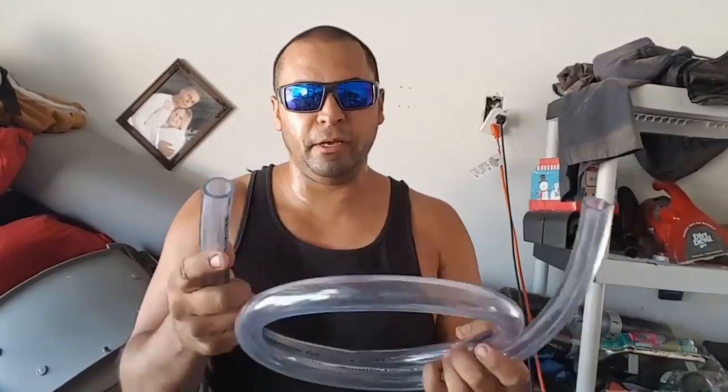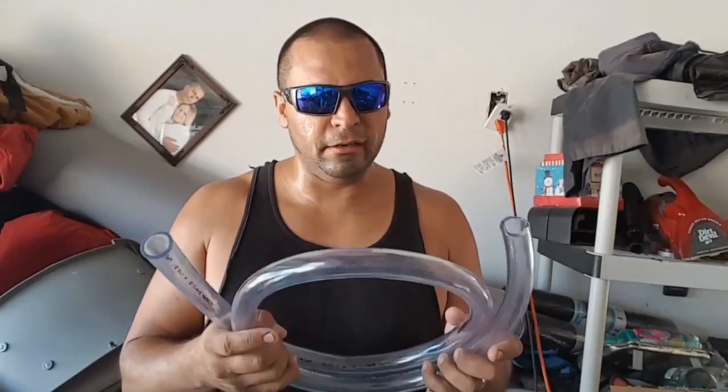We're running three-quarter-inch hose — all three-quarter-inch fittings. If you're going to get hose, braided hose from Lowe's is recommended if there are going to be a lot of bends, because it doesn't kink. I have non-braided hose here because it's a little softer, and my plan is to make a chill box with enough tubing — hopefully four feet, maybe six or more. It's contingent on how well the pump can push water through; the longer the hose, the harder it is for any pump.